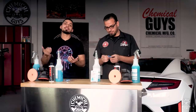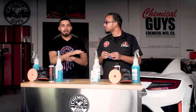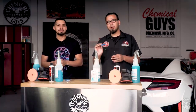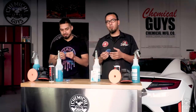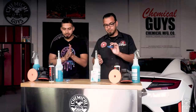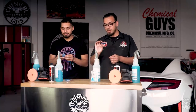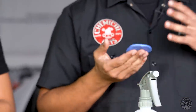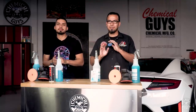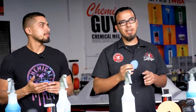So now we'll be moving on to the cleaning process. The reason why we have to clean the surface of the vehicle is because we want to remove any contamination, especially because it's going to get clear bra'd — you don't want to cover up any contamination, you want the proper bond from the clear bra to the surface, and we don't want to clear bra any scratches. We'll be using a light clay bar because this car is fairly new and has been detailed recently. A clay bar is a very sticky substance that extracts contaminants from the pores of the paint. We recommend pulling off a small piece and kneading it into a patty that covers about three fingers — this way if you do drop it, you have to throw it away because it will collect rocks or debris from the ground that would scratch the car.